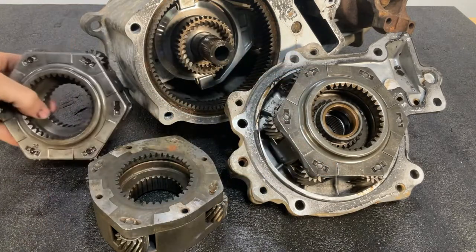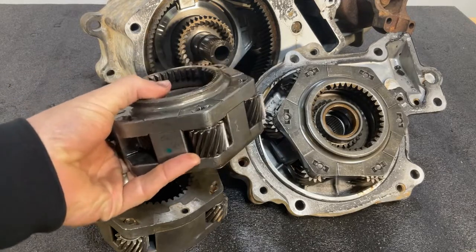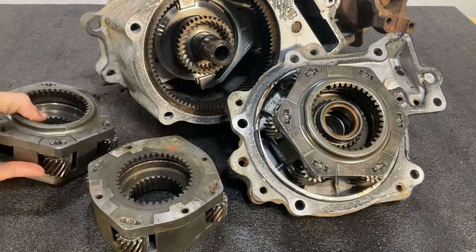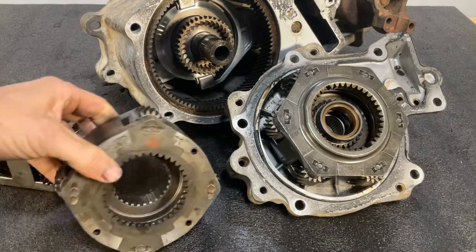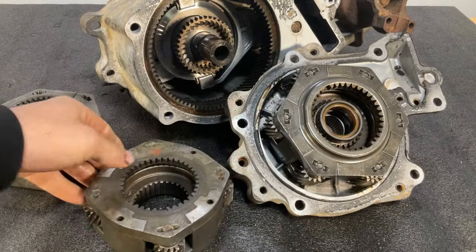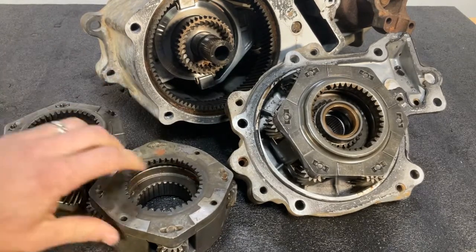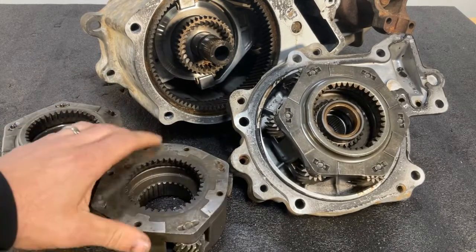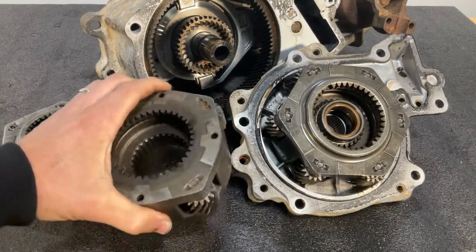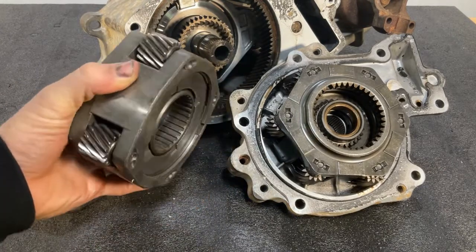Every now and then you'll get into a case with a few of those removed, and it might only have 4 of the 6, but a 1350 is going to be set up where it can only house a maximum of 4 gears. Another difference is this lip you see on this side. The 1354 has the lip, whereas the 1350 does not. So a couple small but very key differences. A 1350 model gear set is not going to work in this Ranger Strongbox.